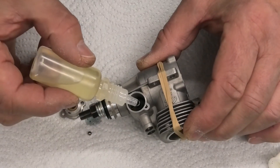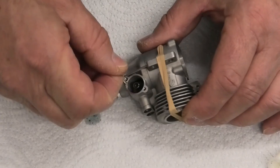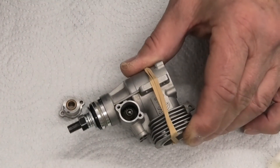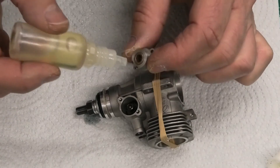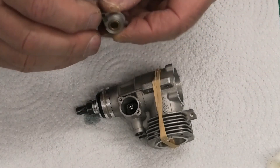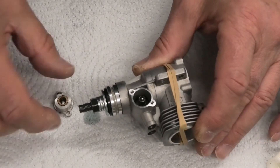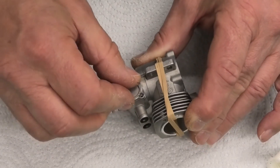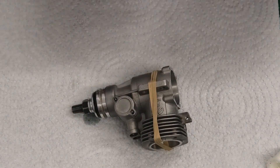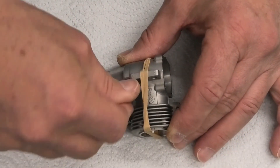So now I'm going to use my wooden stirrer, hold the camshaft in place, and pull off the fuel hose. Now I'm going to put a little bit of oil just to hold that front bearing in place, then carefully put the bearing in — spot on. I'll put a little bit of oil on the bronze bearing as well. I'll put plenty of oil in when I fit the cam followers. And now we can just put in the screws.